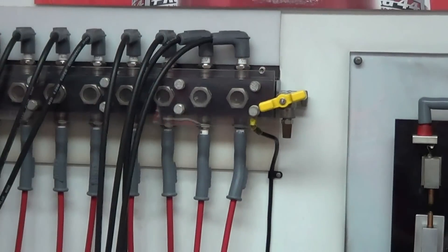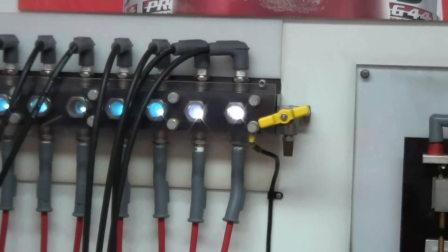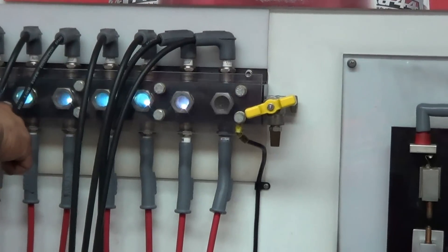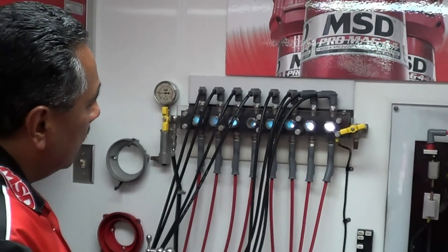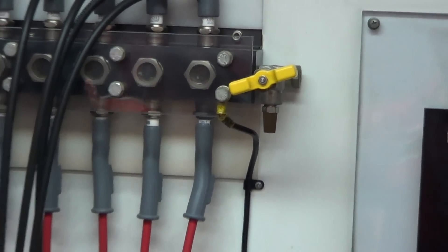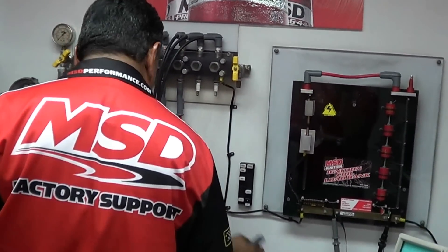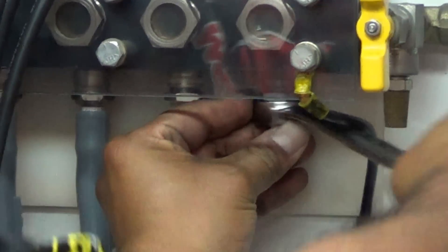It's a big difference, resistor versus non-resistor. That one's jumping down, and then this one over here also? Should jump anywhere it wants to. On the multi-spark plug it's by design — it's jumping down. It's just not quite as bright. In fact, the non-resistor one is not quite as bright as this.